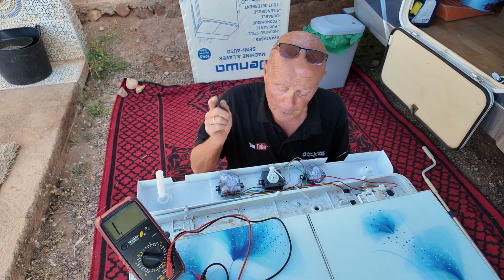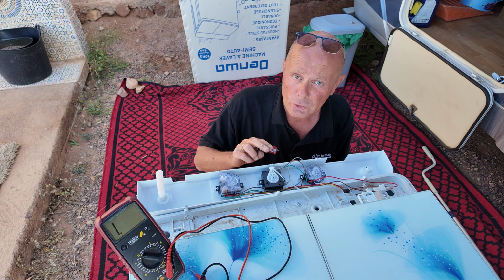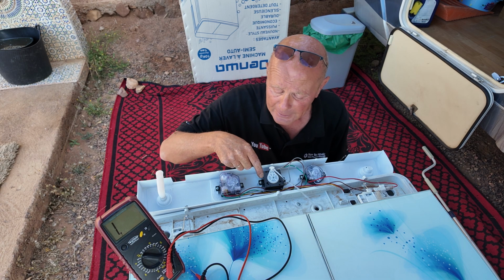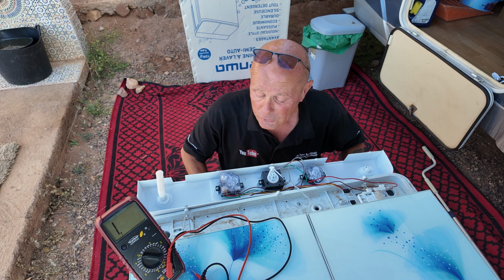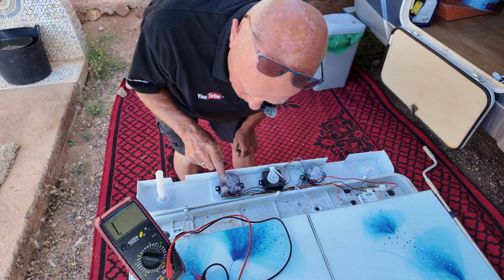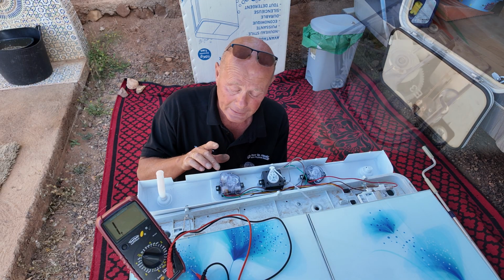Straightforward and simple. The switch in the middle, as you saw at the beginning of the video, basically is for the 2 wash functions and also to turn the agitator or wash plate off when the machine is emptying. And that can easily be tested, but nothing is visible on here. The next switch is a switch which controls the rotation of the wash paddle. And if you look in here, you can see 3 sets of contacts.